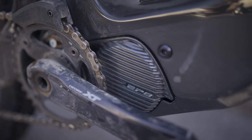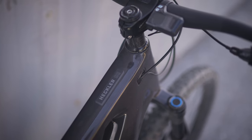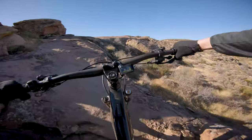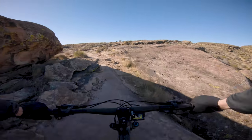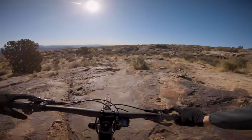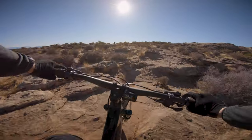I don't get caught up in the ultra-technical stuff when it comes to bikes, especially e-bikes, because there's some sort of voodoo magic I just don't understand. I try to focus on the things that actually change how I feel when I'm riding, or how much fun I have. So the first thing I find super important: is there enough power? And yes, that answer is yes. With 85 Newton meters of peak torque, there's tons of torque on this bike — it honestly feels like there's maybe a little too much at times. When trails get tight and technical, the highest power mode actually makes it a little more difficult to control the bike. It's hard to balance and maneuver and keep the bike going where you want it to go when you have so much torque. So when I'm in really technical twisty stuff, I drop the power mode down to the middle or lowest so I can manage the bike a little bit better.